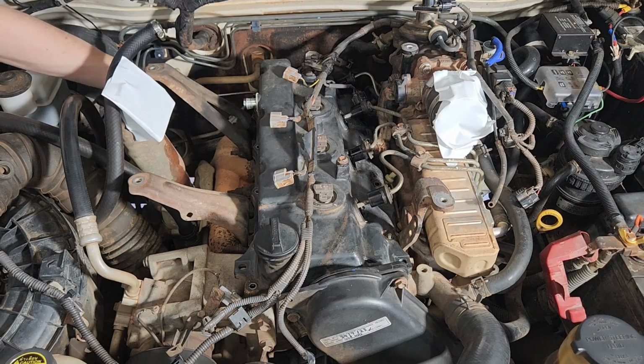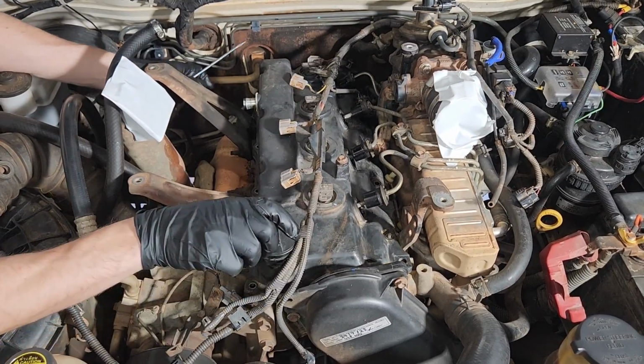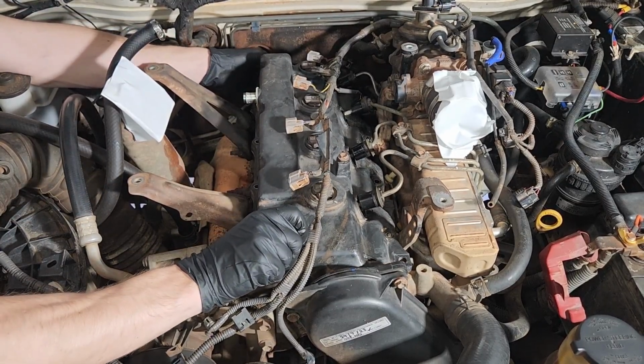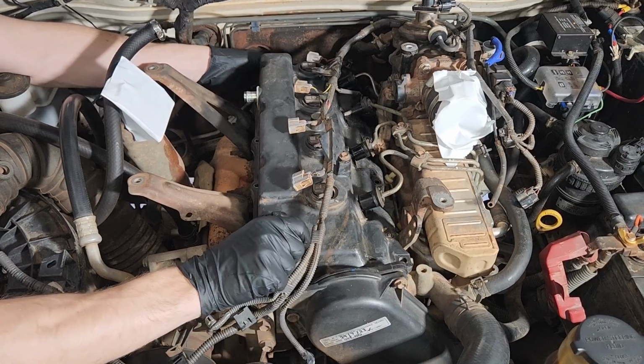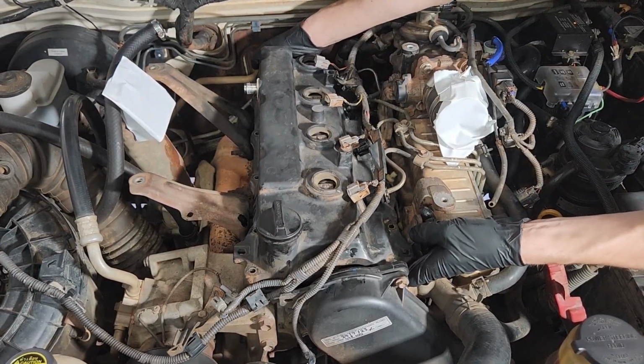We don't actually create a permanent bend. We just sort of flex them out of the way, and the rocker cover will actually still be removed while the injector lines are intact. We can undo the clamps between them to make them a little bit more free, and we can entirely remove the injector lines if we want. But for the most part, this is pretty good.